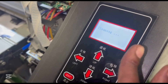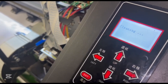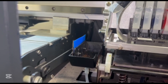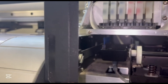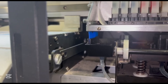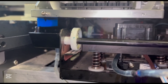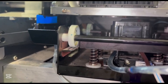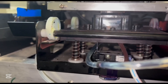Next you're going to do a clean nozzle. A clean nozzle does three things: it pumps, then after pumping it wipes, and then after wiping it does what we call a spray. Checking the process now — it has just pumped, and you can see the wiper is going to clean. There we go — it completely comes across, wipes, and then it spurts.